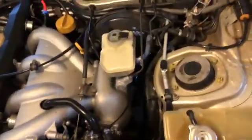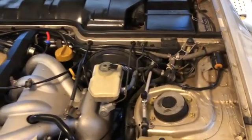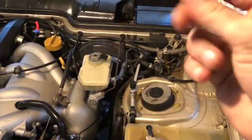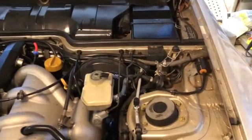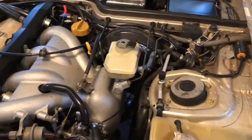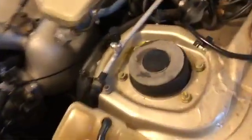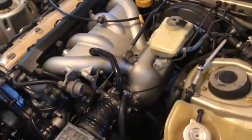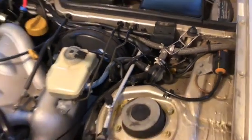Well, after some thorough bleeding and some additional investigating, I think I am seeing a little bit of moisture on the master cylinder inside. So where the pedal is in the little boot, there's a little bit of fluid in there, and there shouldn't be. So I think my master cylinder is failing, and with it, I think the slave cylinder is also on the way out. So this was part of the process. Bleeding it, as I thought, did not bring it back because I was afraid something had gone bad. So it looks like we're gonna be replacing the master cylinder on the S2. Yay. And probably putting in a new slave as well. So at least I'll get another round with a video, and I'll show you guys that when it happens.